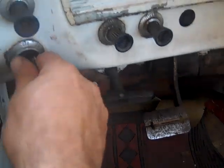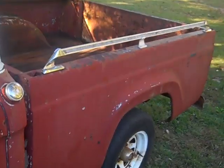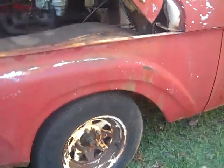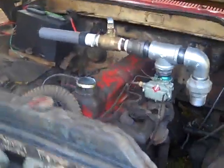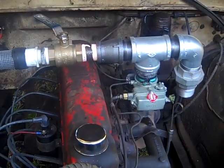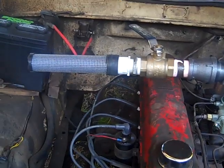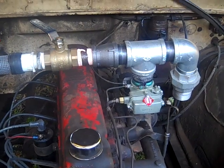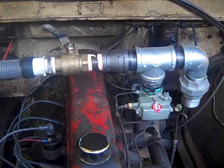All right, just in case you didn't know how to turn a truck off — film everything! We also redid the brake wheel cylinder today, freed that up, so we've got brakes all around — shoes are good and everything adjusted. So I've got brakes and we are mobile with a '62 Ford. Hopefully by the end of next week we'll be driving this around the farm on the wood gasifier. Just giving a little update and signing off.